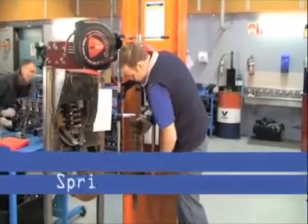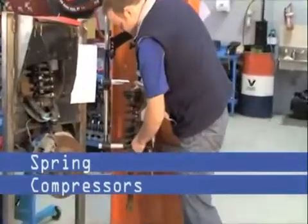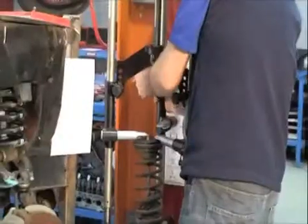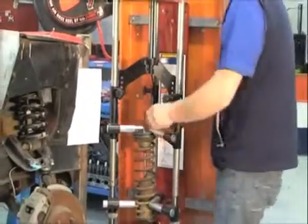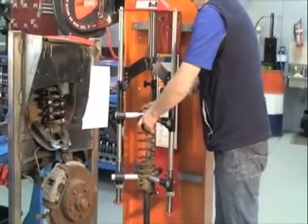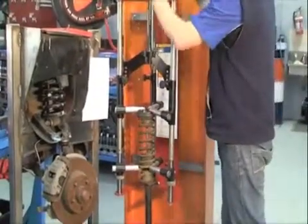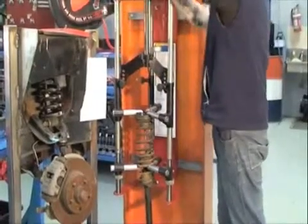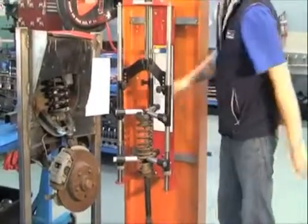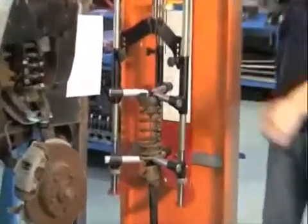With this, you bring your lower ones into place. You've got a fully adjustable piece. You can simply just undo your top bolt, slide the strut out, slide your new one in, do your top bolt up and unclamp it, and drop it on.